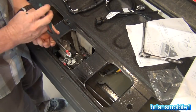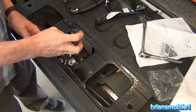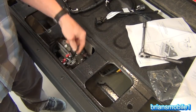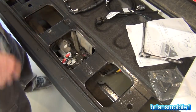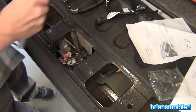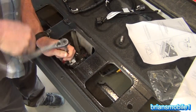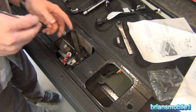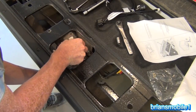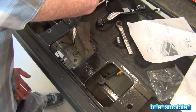Once you do that, you'll see where the tailgate handle is, and you can just pop these off. Use needle nose pliers and just gently finesse them off. Get these two to point to each other and then pull up your cables. If you close the tailgate at this point, you're going to have difficulty getting back in without reaching around manually. We've got our 8mm socket and an extension. What you don't see is I'm using a magnet dish off camera — these make all the difference between spilling and making a mess and getting the job done. Our power lock mechanism is out.